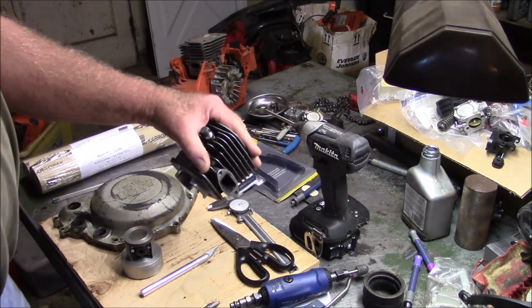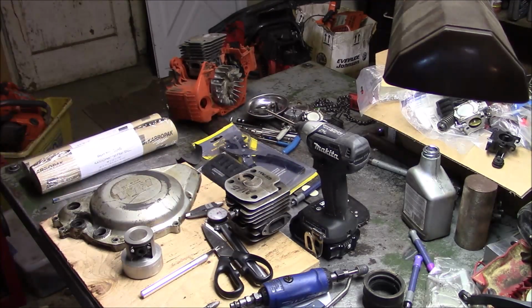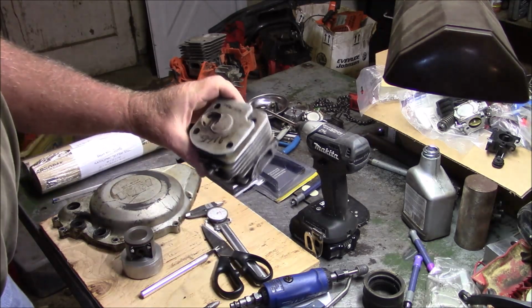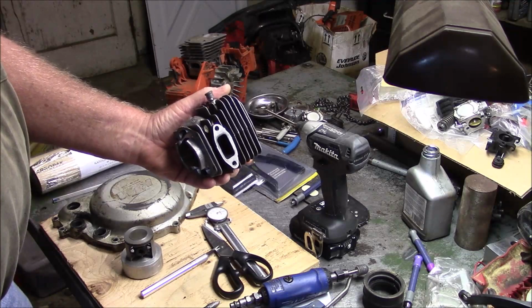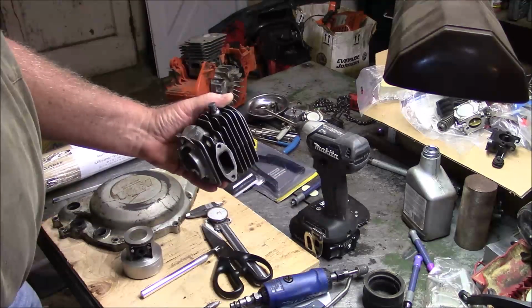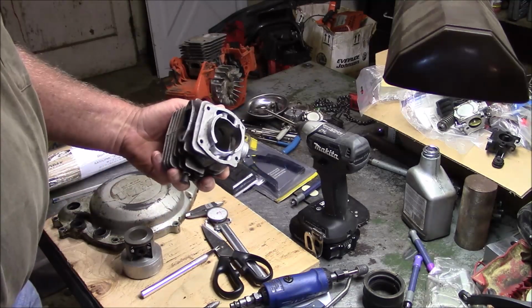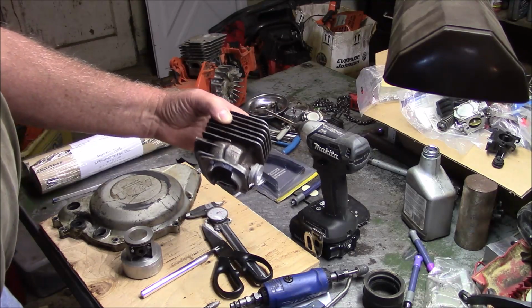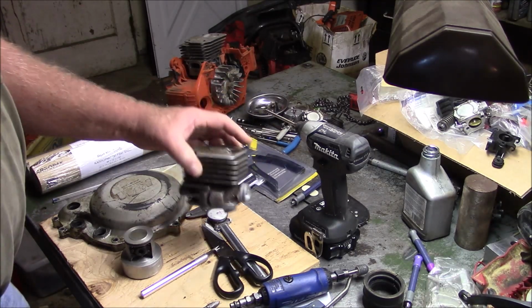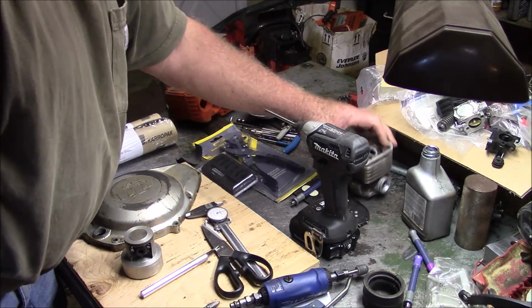I'm looking for a saw that's going to have a no-load tuning reference in the 13,000 range, up from 12.5 for these stock. And I've done some very minor things to the cylinder in order to try to pick up the extra RPMs and a small timing change, a little bit of work on the transfers. The basic cross-sectional area of those transfers really hasn't changed, so the place where it wants to make power really hasn't changed.